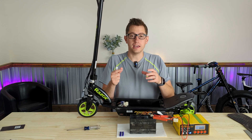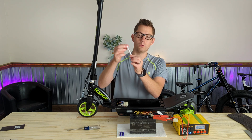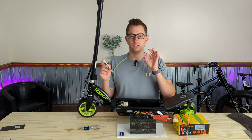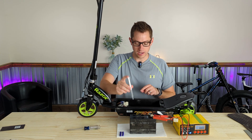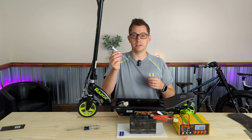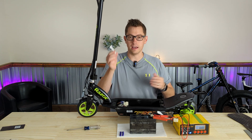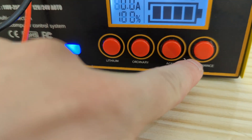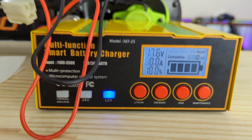A couple of these cells were pretty full, and now they're all just topped off and even. I let the bubbles rise to the top in these six little ports, and then ended up filling them again with a little syringe out of a children's Tylenol bottle — so much easier than doing it with a funnel. If you're doing this, get one of these little syringes; you can top them off and pop the bubbles with the tip so you can make sure you fill them all the way up. It's nicely filled and topped off, and it's on the charger in maintenance mode — says 'repair' — hopefully after a night of this it will be back in business.